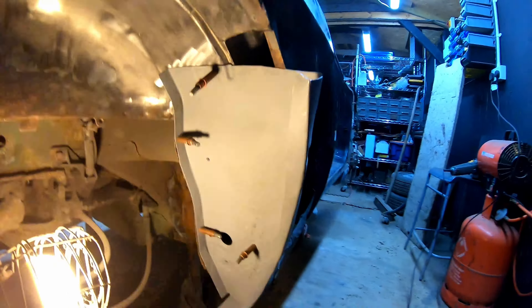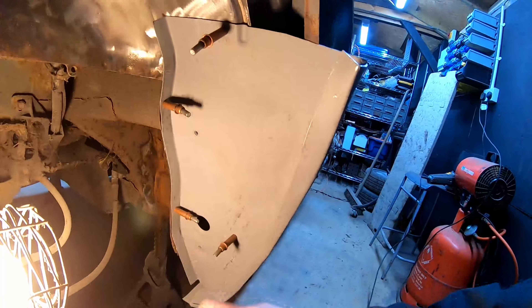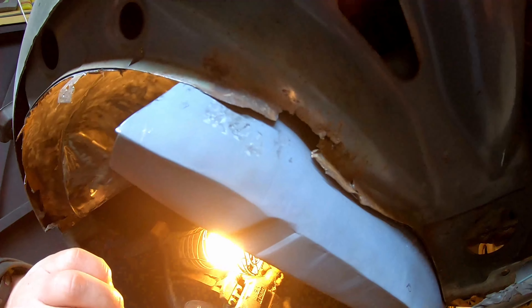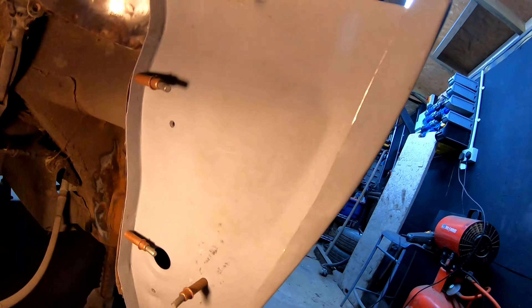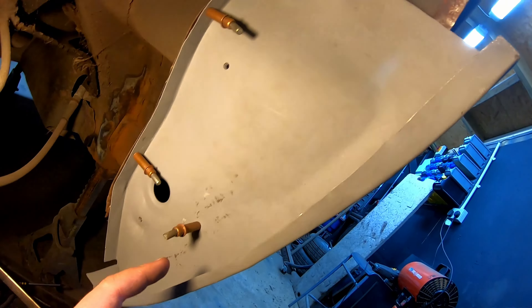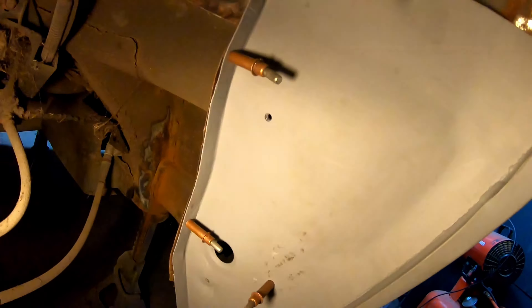What I've been working on is fitting up the sill ends we made — they fit up quite nicely. It took a little bit of tapping to seat it in there. Even the flange on the back fits quite nice. I'm going to have to repair this bit, but I'll get around to that. There's a bit of a gap there but I'll be able to pull that up. I might drill through the front because I'll have to plug weld to that flange anyway, or I could probably get my spot welder on there. I might drill some holes to put screws in and pull it all the way up. It fits quite nice — looking good. Nothing's going to be welded in just yet until I can test fit everything.